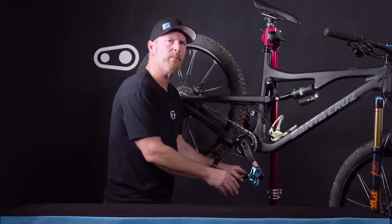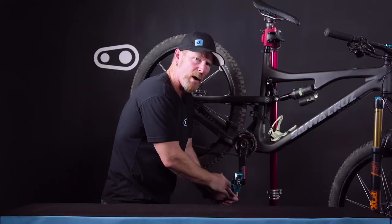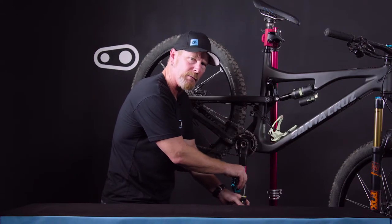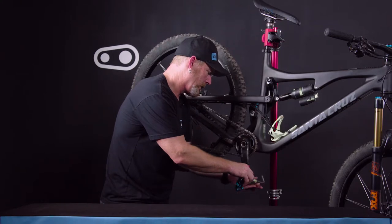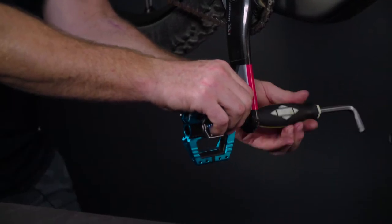You orientate the wrench behind the pedal, parallel to the ground, and force the pedal wrench downward towards the ground, always working away from the drivetrain. You'll be careful — even if you slip, or once the pedal breaks free, you won't injure yourself. With the removal, it's towards the back of the bike in the spinning direction.